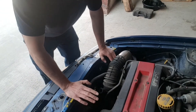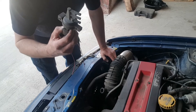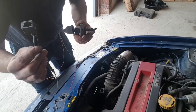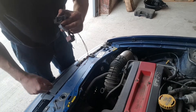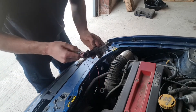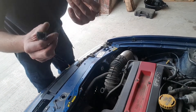So now, if you run the Saab and you want to do a T7 APC mod, clearly you'll need a T7 APC — about £27 delivered. Obviously you'll need the 2-pin plug for the wiring. It doesn't have to come off that specific one; there's plenty about — one being on your temp sensor. If you've got a spare, cut that off, or a horn connector — they're all the same. Even the windscreen washer motor plug is the same. Obviously don't cut it off your own car, but I've got plenty around if anyone requires any, just drop us a message. So basically you want a T7 APC, 2-pin plug, and some terminal removers.